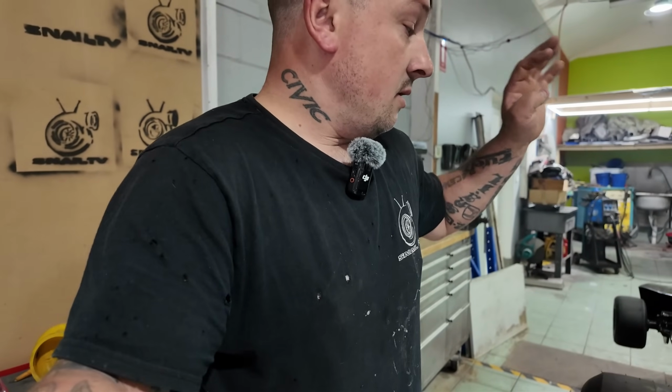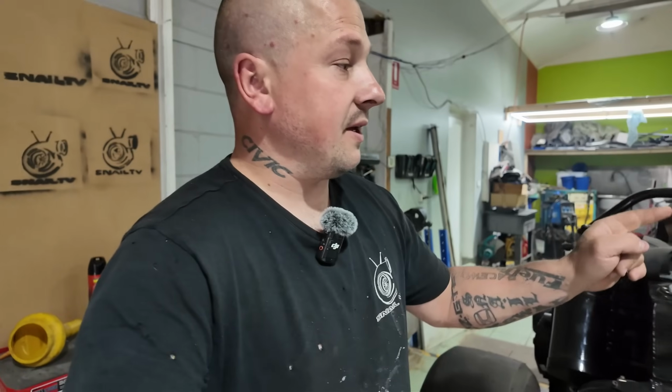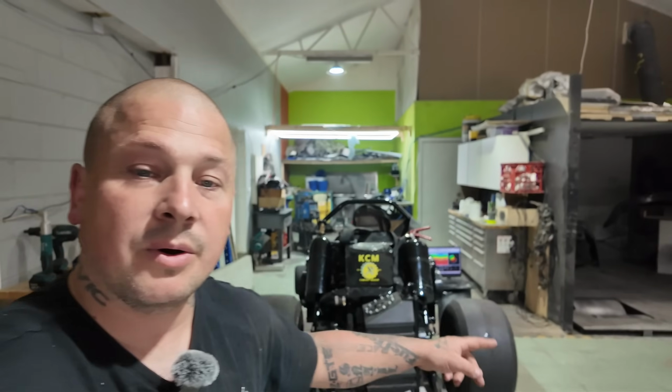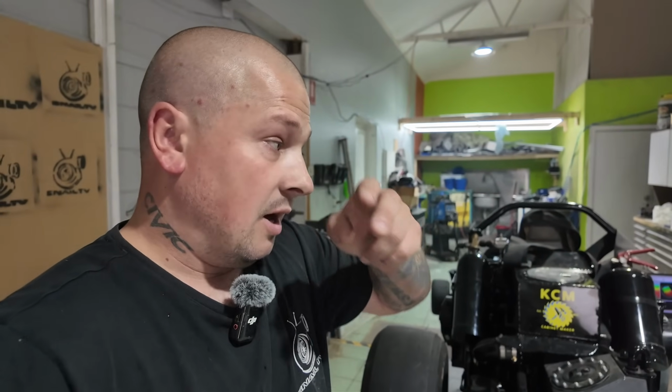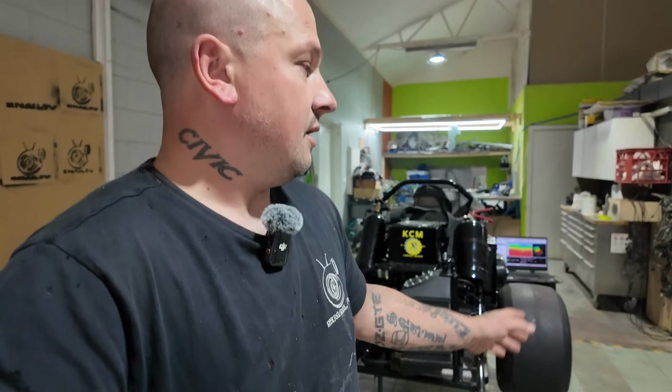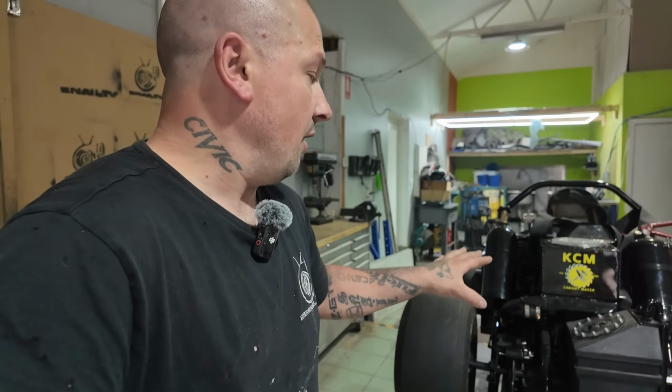Look, really close to dyno. I've got a couple of things coming for the dyno. My rear wheels are about 80 mil off, so I've got some wheel spacers coming. I'm going to put the spacers on just for the dyno and dyno only. I could modify the dyno to make it fit as is, but there are some pretty thick plates, so I didn't want to cut that stuff up. There's really no point. It's a lot easier to get a couple of spacers on here, whack it on the dyno and go from there.